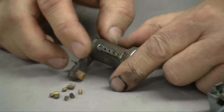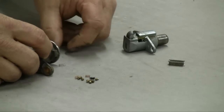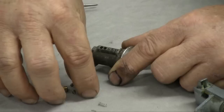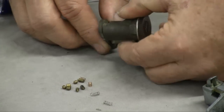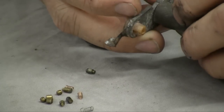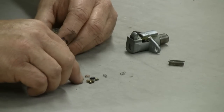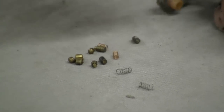I've mucked up one of my springs, but I'm not going to be using all five holes, so it won't matter — I have enough spares. The small spring that got damaged is what provides pressure on the pins inside. There are usually two pins per hole: the lower pin has a rounded base, which sits at the bottom of the hole, and the upper pin may have a shoulder on it — you won't find shouldered pins in aftermarket locks.